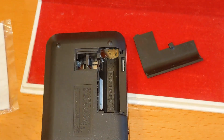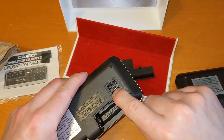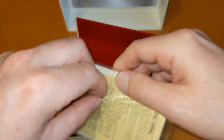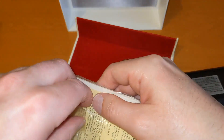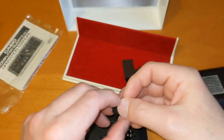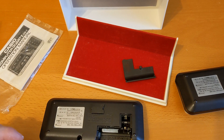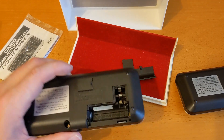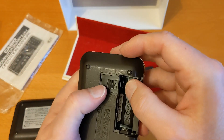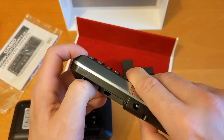Let's switch the batteries over. These batteries — the button cells — operate the clock and the calculator, I think. And this double-A battery is just for the vacuum fluorescent display. I'll just hold it in for the time being. Now it's falling out — there's not enough pressure on that spring, so I think someone's tried to repair this. What I'm going to do is jam the end of this down to put a little bit more pressure on the spring and make contact between the battery and the battery contact, just to see if it's going to work. Very difficult to do.